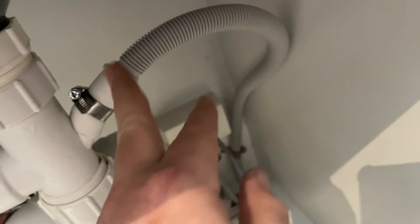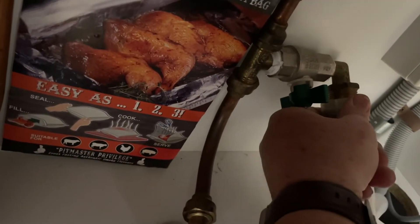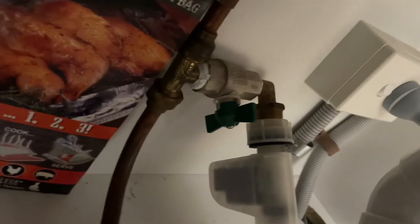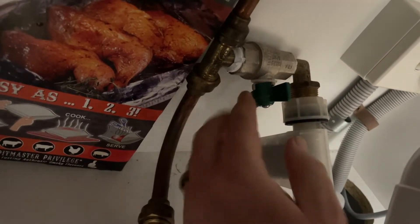Plugging in, switching on and off — the drain hose is connected to the dishwasher, we've pulled it through and run it in making sure there's no kinks. This is all good and flows straight into the drain, so it can drain because that pumps out under pressure. The water in is right here. Ours is on a tap and this is exactly the same as your garden tap outside — you just screw that up. Take notice of the fact that it's plastic, and because it's plastic you don't over-tighten it, just screw it up and you've got a tap here — across is closed.